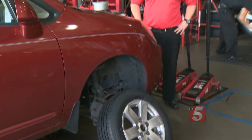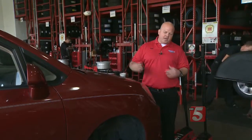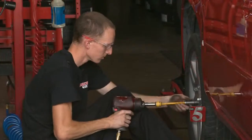It's important to rotate the tires frequently — it is recommended between every 6,000 and 8,000 miles. The reason is it's going to help those tires wear evenly between the front and the back. The more frequently you rotate the tires, the more evenly they're going to wear.